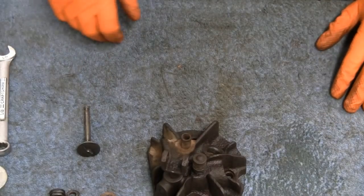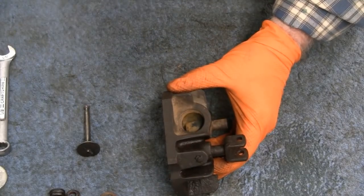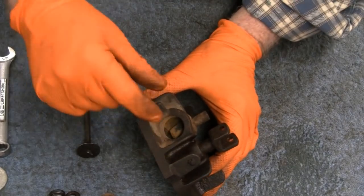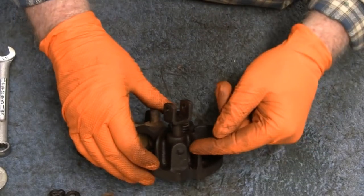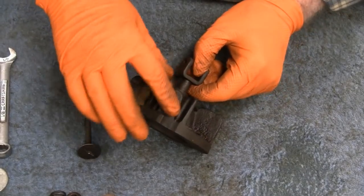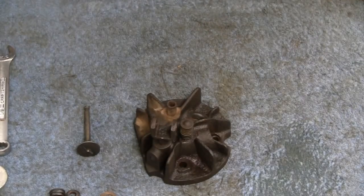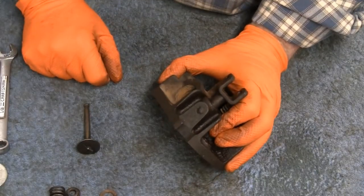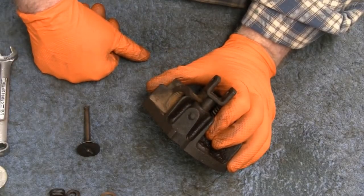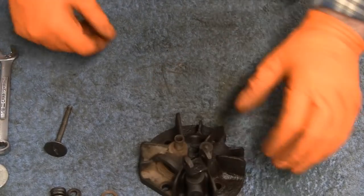So, all right, let's see what else. I guess the next thing we'll do is try and drill this hole out. Looking at it, I might be able to get some heat on it from over here without affecting this other spring. Get a little heat on it from there, and maybe from there. And we're still far enough away from that spring that it won't bother it. So we might do that. But first we've got to grind that down, center punch it, and drill that out. And I don't have such high hopes. See, now something like that, there's enough room there where I could drill that whole thing out and put the next size bolt in. So, all right, let's see what we can do.